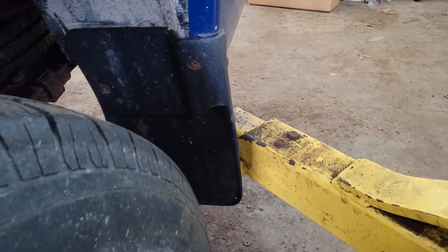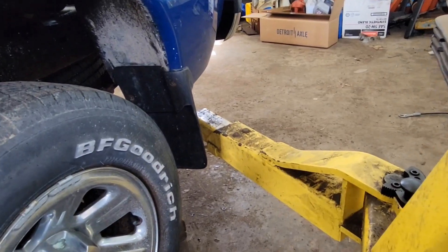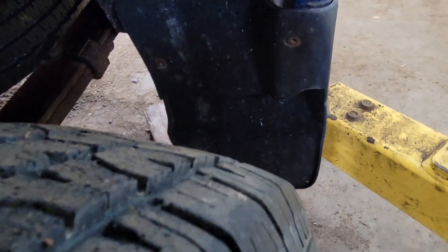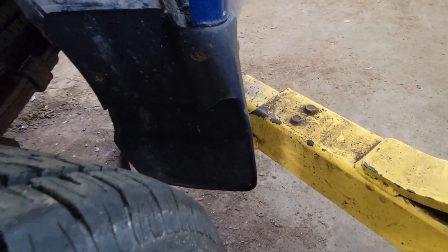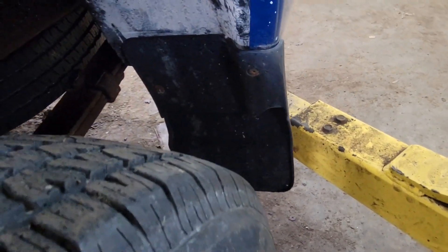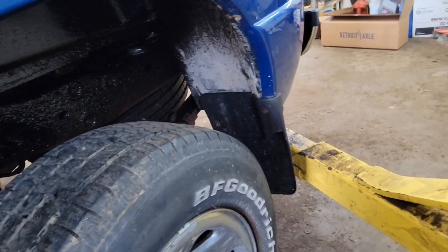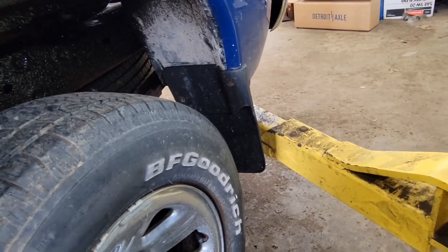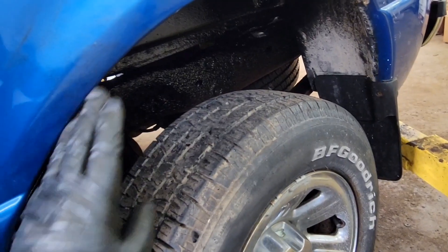You can leave that mud flap attached — that's what I did. I pulled out the one long screw that was here. Then there's a metal bracket on the bottom of the mud flap on the back that goes up to the bed — that's your 13mm. So you pull that off. Do that on both bed sides: underneath the step, underneath the tail light, by the back bumper, that one bracket under there, and then all the way around your wheel well on the outer edge.